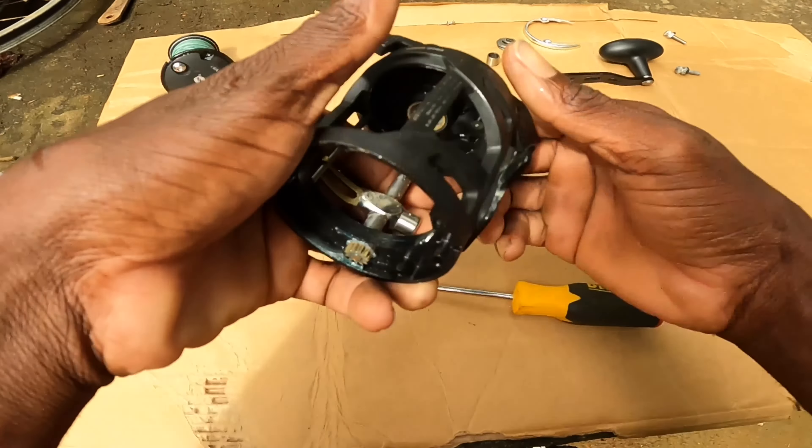Right here is our problem. We're trying to see what's wrong — why it doesn't snap back into place. You see this little part right here? This is what automatically engages this. When this is spinning it causes this to snap back into place — that is what gives you the whole automatic engage. So I'm gonna fill this up with some grease, not too much, and I think that should solve the problem. We're gonna add a little inside just to reduce the friction and all of that.